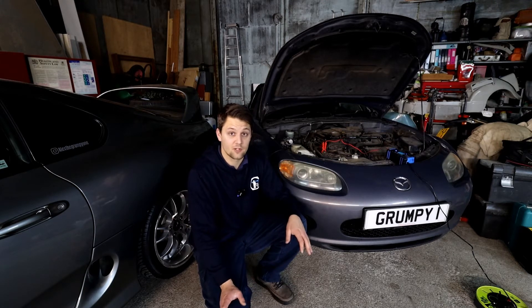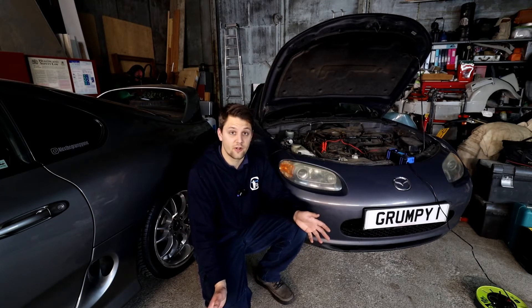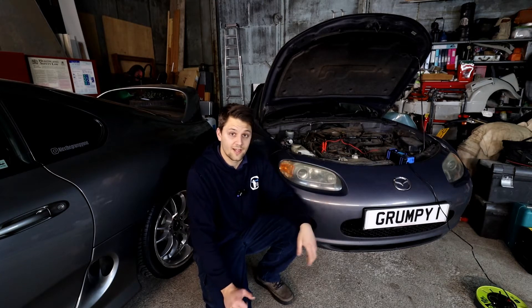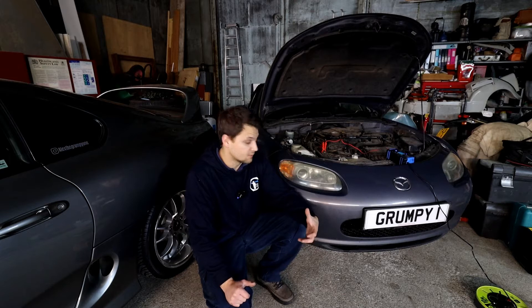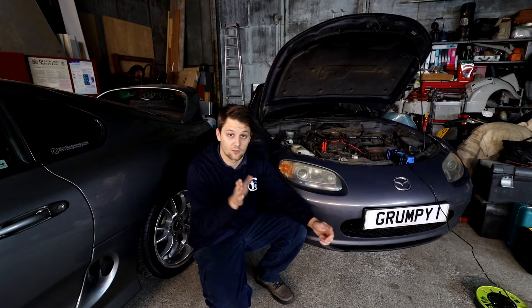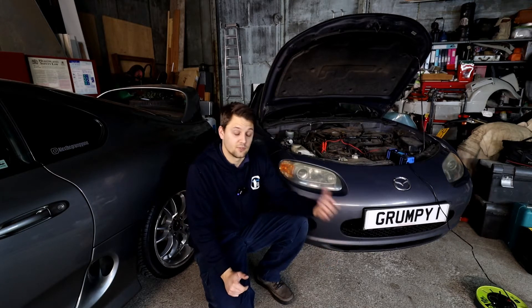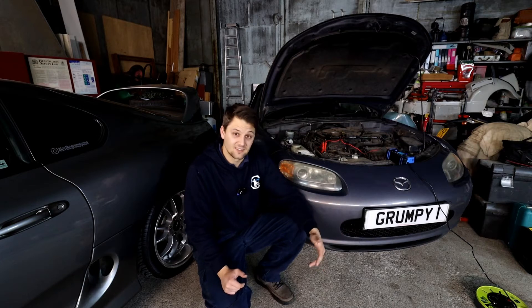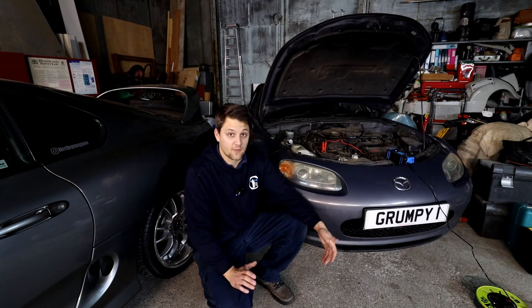What happens is in case you have a flat battery or you replace the battery, you start the car up and you have yellow warning lights on the dashboard. This is specific for the stability control light — a little yellow car with a couple of waves. That light will stay on even after driving the car. You can scan it and sometimes it does give you the steering angle sensor issue, but that doesn't mean you have a fault there.